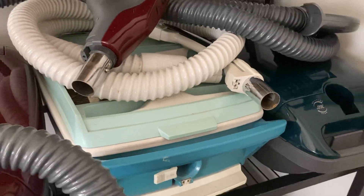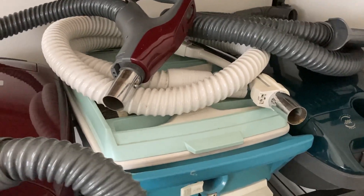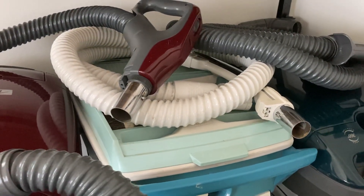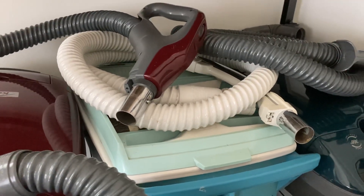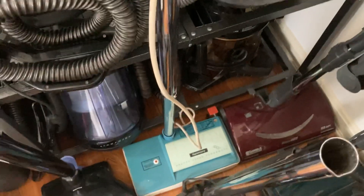This is a Kenmore Magic Cord canister. I got it from my uncle who saved it out of the landfill for me, and this vacuum has had a ton of work. I replaced the hose with a new old stock plastic hose I found at a thrift store — these hoses don't crack like the old vinyl ones do. I got a full set of tools, repainted the metal base since it had surface rust, had the motor serviced, had the cord wheel replaced, and found the original-style powerhead — this blue one — that would have gone with this machine.